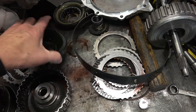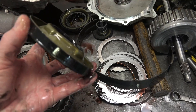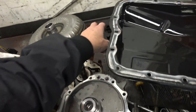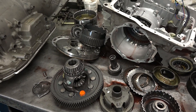The hydraulic pistons that apply the clutches have rubber seals on them, and those are no good as well. The metal is just eating up the rubber lip on the seals, so we're going to have to replace that. And obviously a new filter. And we're going to have to flush out your cooler lines and the cooler system.